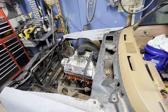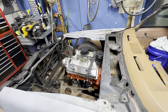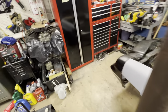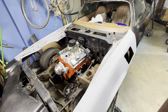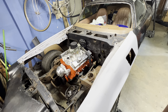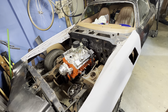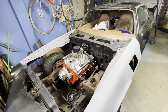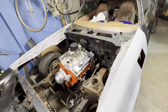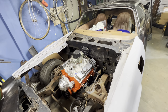We'll have the four-speed, probably do some long tube headers. If I get really tired of the headers I'll go with exhaust manifolds, because I'm not trying to be super aggressive — headers are prone to leaking and can be a real pain, whereas manifolds are usually leak-free and trouble-free. Power steering will go back on, we'll get the vintage air going.